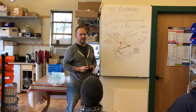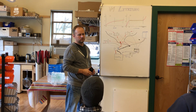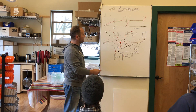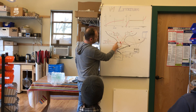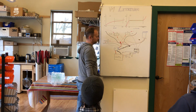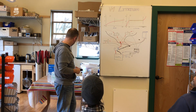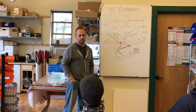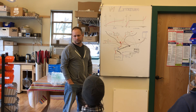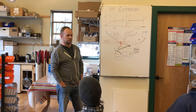What makes these systems more complicated is that we actually have to separate loads from charging sources, and in RV applications those are often combined somewhere and we have to find and separate them. That's what causes the extra labor. In most RVs, before the cable meets the house battery, loads and charging sources are combined — the alternator or generator shares the same cable as DC loads. The V4 system provides a load relay disconnect and a charge relay disconnect capability once you separate them.